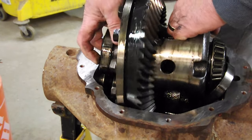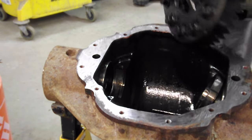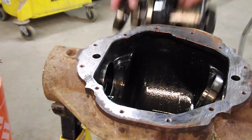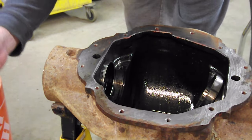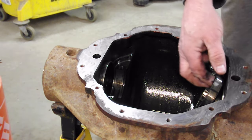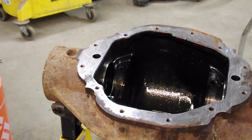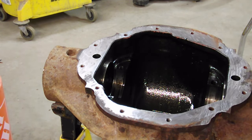If you're reusing anything, keep them separate. Don't get this bearing cup mixed up with that bearing cup. I set them on my bench. If I had a trolley bench working underneath the rear of this truck, that's what I'd be using. I'm just going to pause for a minute and clean some oil off my hands.